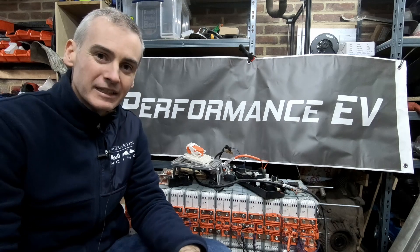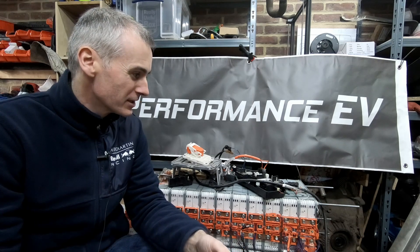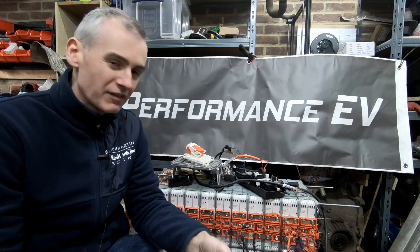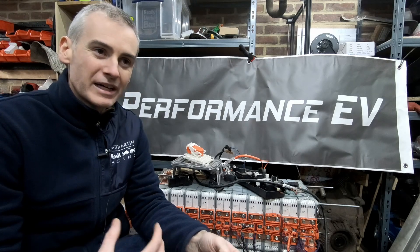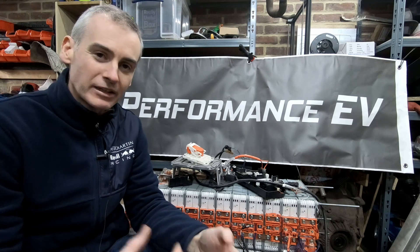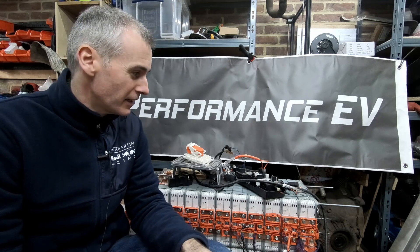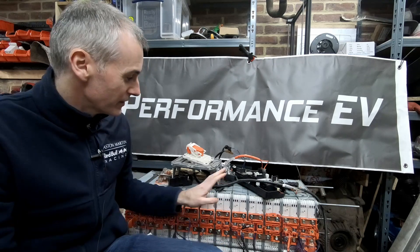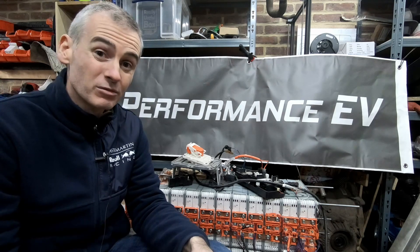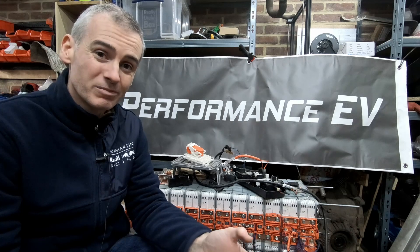I spoke to it briefly in the last video. Basically, I'm going to get some or all of the battery box components actually built out by someone who really knows what they're doing. Therefore I'm not going to have to worry about over-engineering a particular join, because I don't know the calculations around weld strength and that sort of thing. So that should allow for a much more robust pack, hopefully something that's going to stand the test of time and carry the weight of this battery pack in the car. But it does have a knock-on effect on me — in order to get other people to build something for you, you need to provide them with enough information that they can do a really good job.